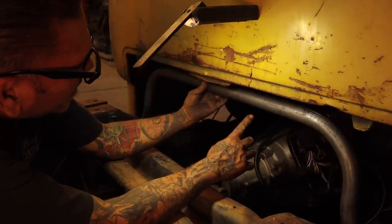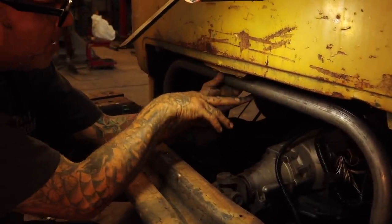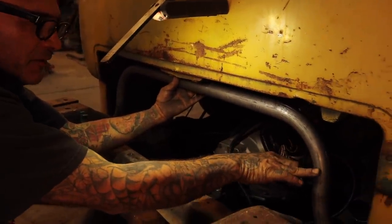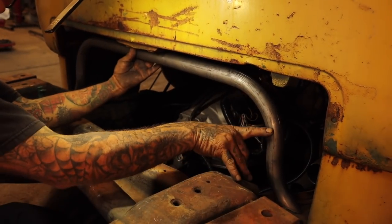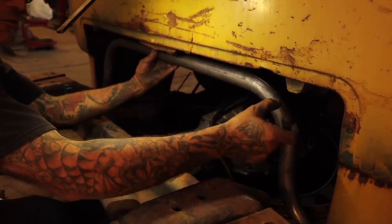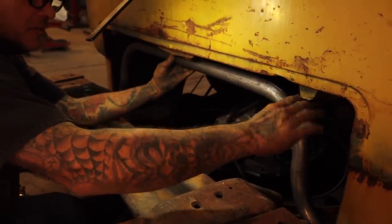And we got the first cross member made. What we'll do is we'll make a bracket from here, wrap around this way, weld it here, weld it here. We'll put a reinforcement. We can't go too high here because the box sits right here. So we'll put a reinforcement from here to here. And then we'll make the tubular coming off of here with the little bracket holding the cab right here.